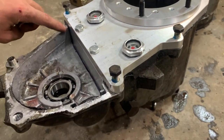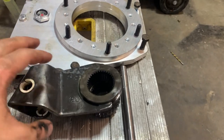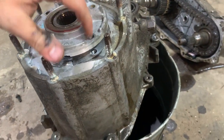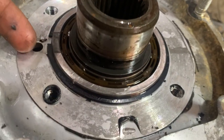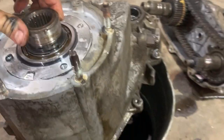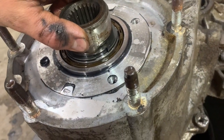I'm going to start with a sawzall and try to cut this. Now I've started disassembling the case — I pulled the pin out, pulled the shifter out, and set everything on the bench. I took the bolts out and came in right here to pop it up and break the seal. Under here there's a little snap ring around the input shaft, and we're going to have to pop that off to allow the planetary set to come out, because you don't really want to be cutting and welding while the planetary set is in there.